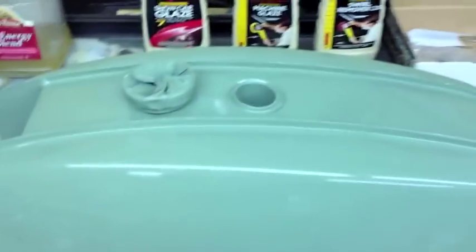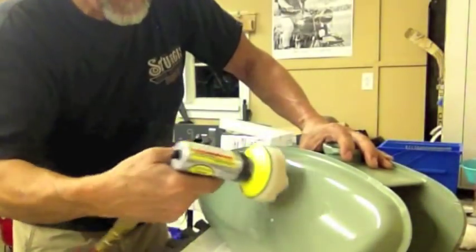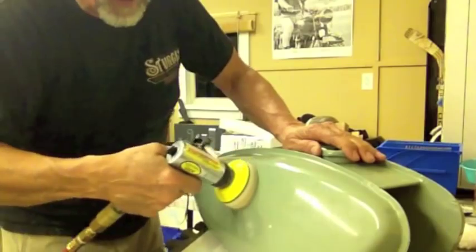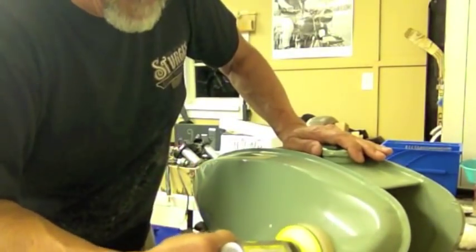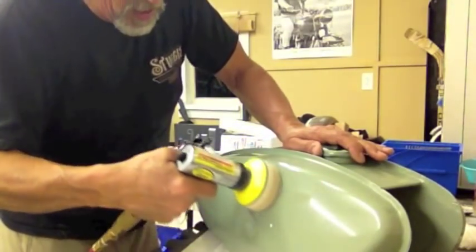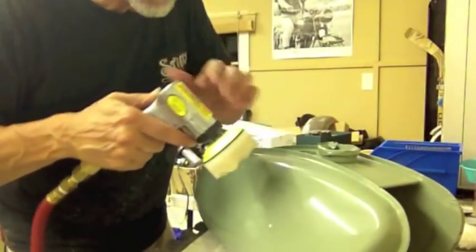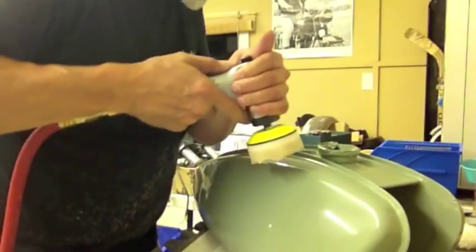That's what I was worrying about a little bit, but it's starting to come around. What's happening now is I'm taking this applicator with the machine glaze, applying it — this is all saturated so I can still use it. I'm just not putting a lot of pressure on it, just taking it to the next level of buff. You've got to watch out on these corners because you can just go right through your clear coat and your base coat, and you'll be fairly mad at that point.